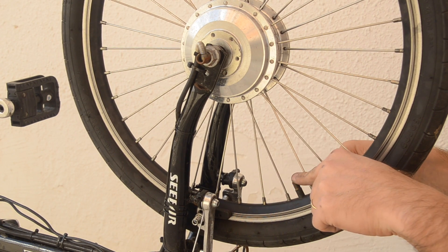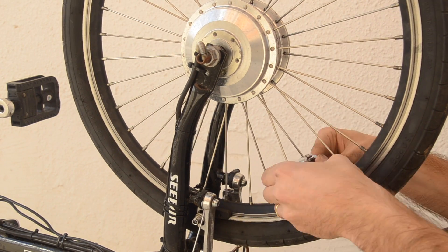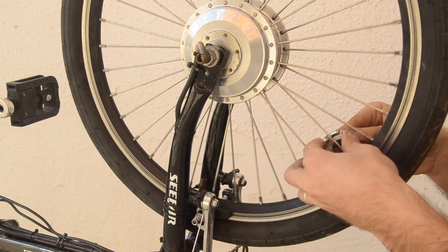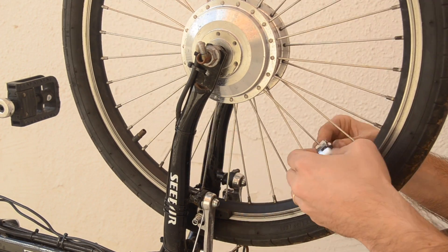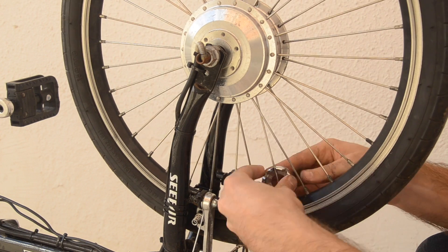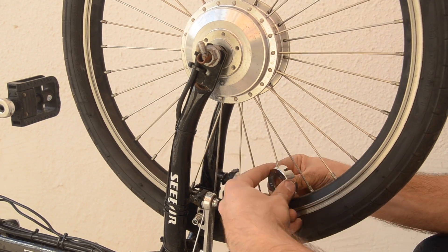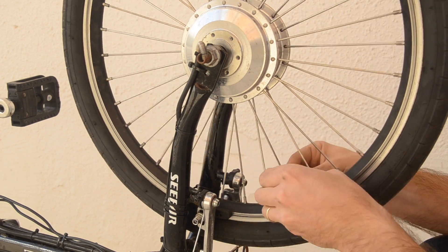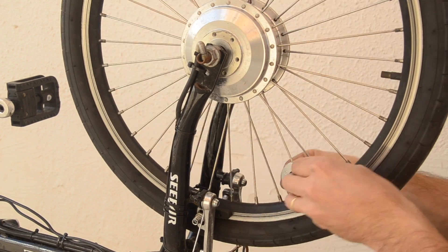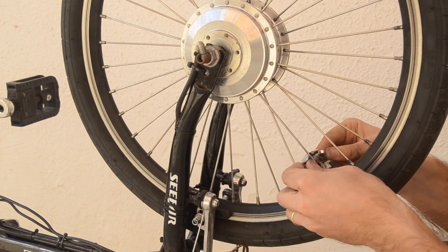For the final part of the truing, I'm going to start right here with the valve and go around putting about a quarter turn on every one of these nipples. I like to start with the valve so I know where I began and I don't go around more than once. Now, is this the best truing job in the world? No, this isn't a professional truing job. If you're doing racing, or you've got a downhill e-bike, or you do a lot of off-roading with a lot of stress on these wheels, you probably want to go to a professional. This is the general process, but when you do it the right way with the right tools, you can get it a lot more exact. For those of us who just need our wheel to be pretty much straight and true for commuting around town, this will get it done. But if you want a real professional job, you do need a professional. This is the quick-and-dirty method and it works, but you can do better.